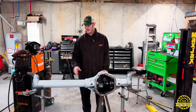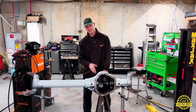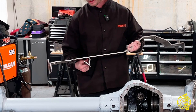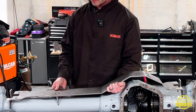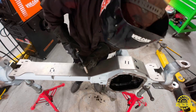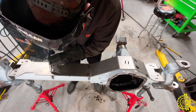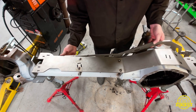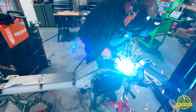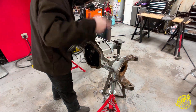Now that we're ready to start putting on our truss, I've gone ahead and applied one layer of Rust-Seal so we don't have to worry about any rust issues underneath the truss. We're going to grab that piece and put on our first section, which is the top plate. We'll use two pieces that key in underneath it — one here and one here. The instructions tell us to tack weld the underside gusset at the keyed points on top of the truss. Once that's done, slide the rear plate into place using the keyed points at left and right and tack weld those. Then take your front plate, slide it into position, and tack weld it on each side — but don't tack weld it onto the tubes just yet.